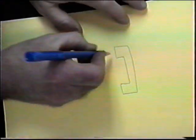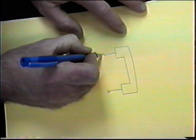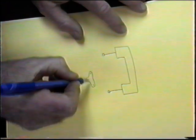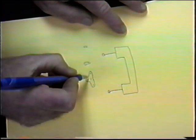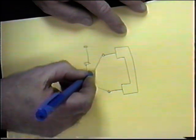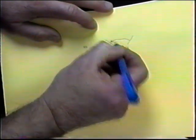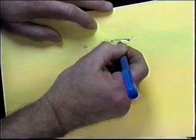Now, I just want to mention handle adjustments. When a cable is coming out, you should always start at what you think is a medium setting, especially if you're using a predetermined set of ratios at this end of the control system, and you're using the ratios on the control horns. No sense making this too fancy, but what I'm getting at is there's a relationship here. This relationship is how much movement you put into the handle over here. And boy, if you understand this, talk about having an advantage of being able to trim the plane.